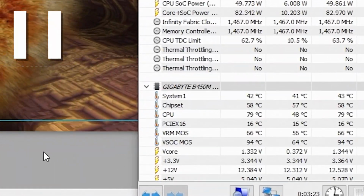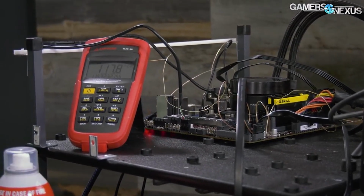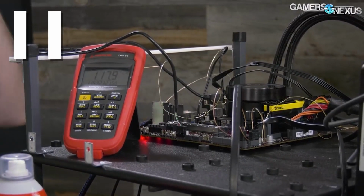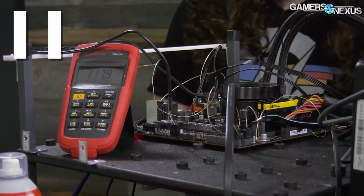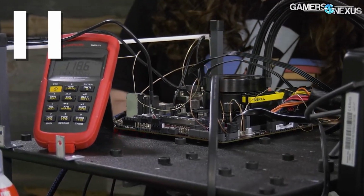Oh yeah, there's something I wish to mention just as I edited this video. After doing so, I had some cooling issues and I checked online after searching. Gamers Nexus had a video about overclocking and they discovered my VRM temperatures were dangerously close to 105 degrees Celsius. For processors better than the Athlon 3000G, and if you plan to overclock it, buy a better motherboard in case you do want to end up getting that.